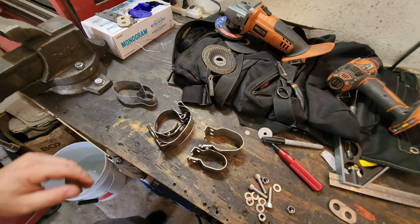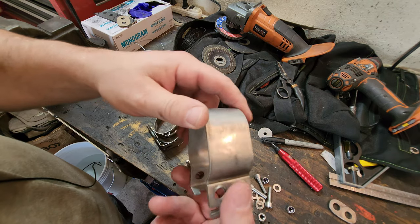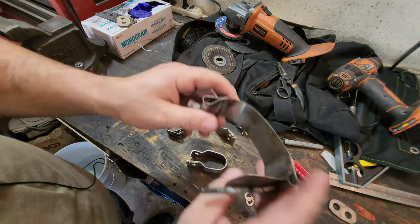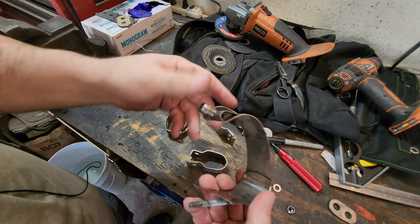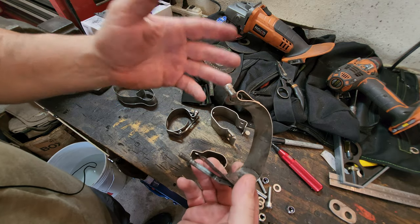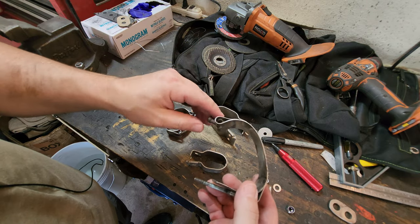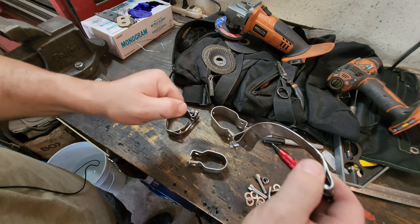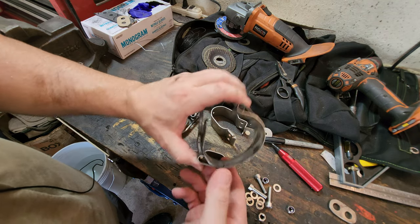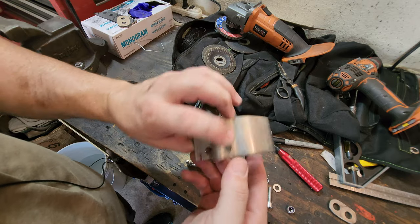All right, looky. So first off, these ones are made out of a lot better stamped steel than whatever the heck these are made out of. It's just super flimsy. And with that, the flex, the whole point of a stabilizer bar is when you're going through turns, whenever you happen to hit it pretty hard, it keeps one wheel planted, at least one wheel planted. If the other wheel starts to come off the ground, it applies that opposite force to the stabilizer bar to the other side of the suspension. So this is not going to be as great at doing that as these right here.